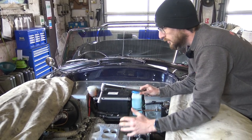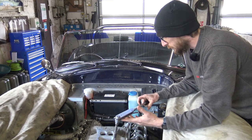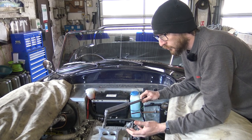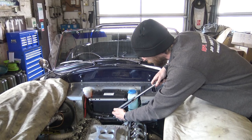With all of the bolts now pulled down, we want to go around and nip them all up to 30 foot-pound. We're going to go around these three, maybe even four times, because every time you go around you will get a little bit more on them.